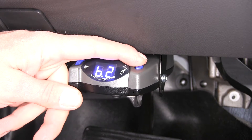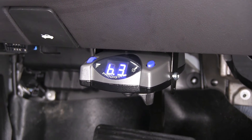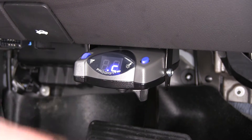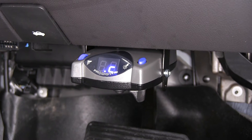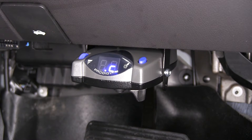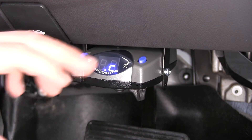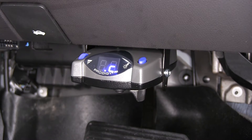We have a boost one, two, and three setting. This is an aggressiveness setting, so if we've got it on the higher setting, we should have a really heavy trailer — maybe even heavier than what the truck is. If we go to that high setting, that's going to give us very quick and very immediate response from our brakes. If we go to the lower side, it's going to be a much smoother and less aggressive braking application.